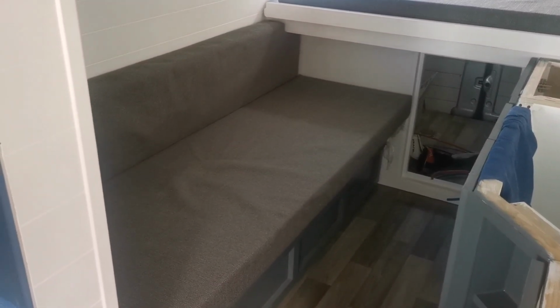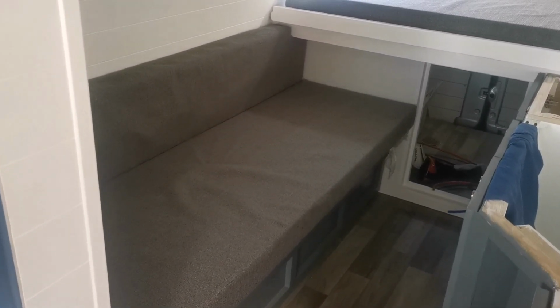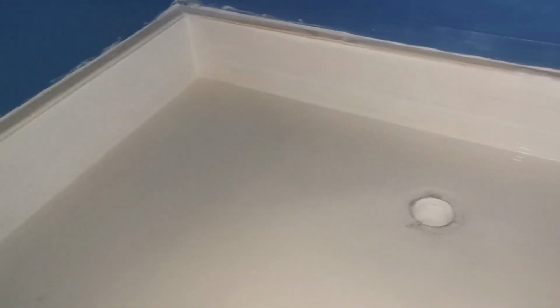I've made this shower tray to my specification. Idea being is I wanted that bed there to be exactly 190 centimetres, which is the full length of a single. And then coming up to the driver cab, I needed those exact specifications. So I basically made it from 12mm ply, and then I used 2x1 and 3x1 upstands to create a nice deep finish. Reason being, a van, you're never going to be parked completely level. So I didn't want any pooling or puddles. So I wanted a nice high upstand.